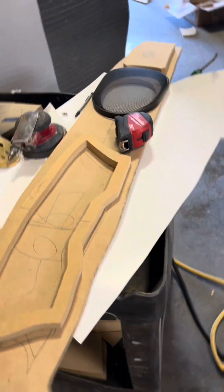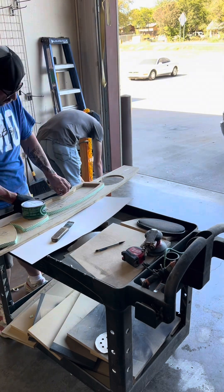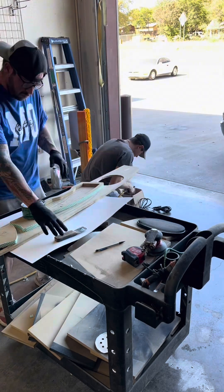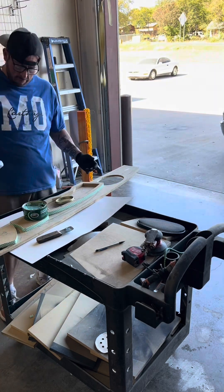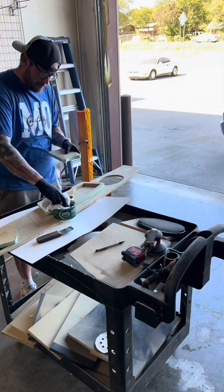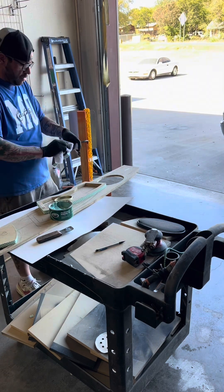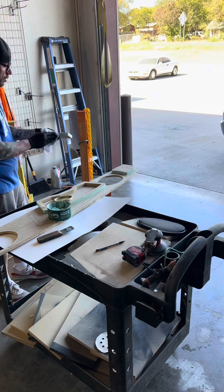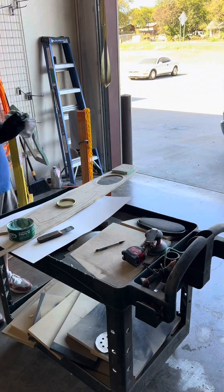This is me getting this package tray put together — it's a long process. We worked on this entire piece yesterday, already had the base portion cut out from the day before, then cut some additional pieces on the CNC machine. Once those come out of the fabrication portion, we wrap them in foam material, which allows us to gap everything appropriately so when we wrap it, those middle pieces will pop right into place.